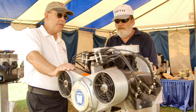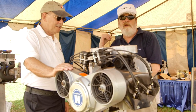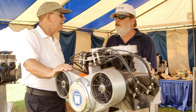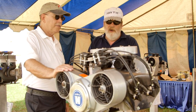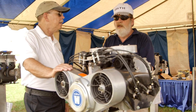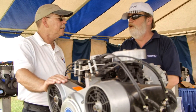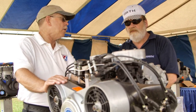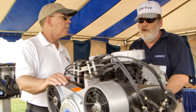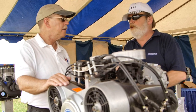The 55 and 65 horsepower engines are also available with fuel injection as an option, and all engines except this one are available with oil injection. Fuel injection is automatic altitude and temperature compensating, immune to carb ice because there's no venturi, and about 5% more fuel efficient. It ranges in price from $1,500 to $2,000 depending on the engine. As for TBO, all high torque low RPM versions have a 1,200-hour TBO, and all high performance versions have a 1,000-hour TBO.